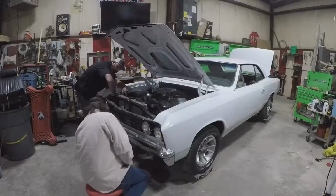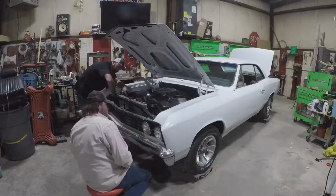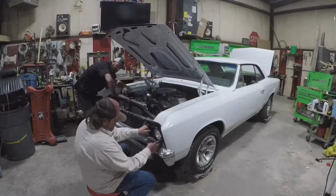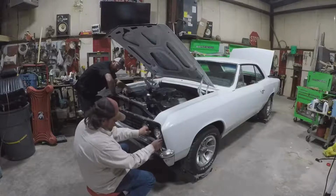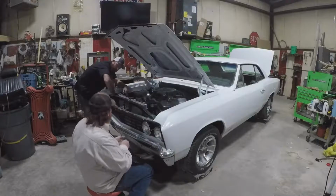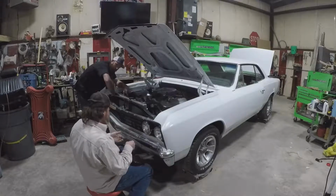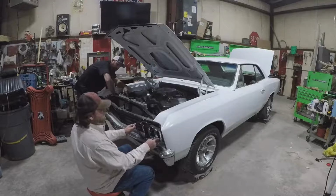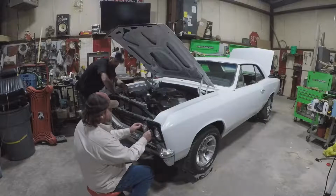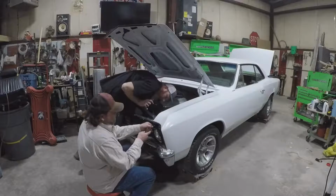So are both of these headlights supposed to have a ground tail off of it? The factory harness, the grounds jump together into each plug, so it kind of piggybacks over. So there should just be one. What did you find underneath there? There was a ground. It wasn't connected. It would just run through the headlight bucket and stick out there. So did it get yanked through there on mock-up or something? Must have, yep. So I put it back through there and we'll ground it to the inside of the radiator support. Seems like a good idea.